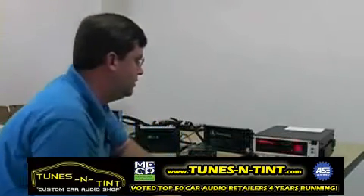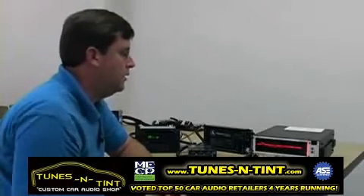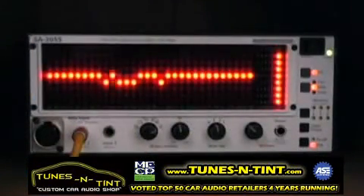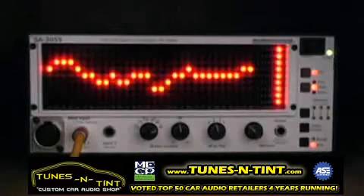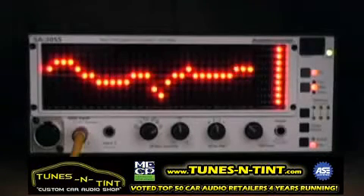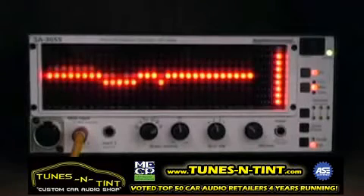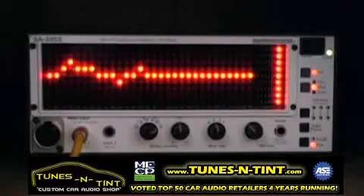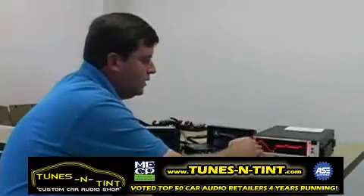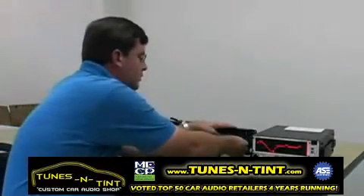Isn't it great when a plan comes together? Four green lights means we've achieved successful calibration, and we did all of this really without even turning on the RTA. So we'll turn the RTA back on to see what we've actually achieved. As you can see, we have a very nice flat frequency response to work with — we're monitoring the front channel at the moment. I'll defeat the Clean Sweep momentarily to show you what it started with. Now we'll look at the rear channel results, and we can see that we've achieved a substantially flat result on the rear channels as well. Remember that that had a very high high-pass frequency — it actually staggered — but the Clean Sweep was able to fill in that range and get it corrected relatively flat.